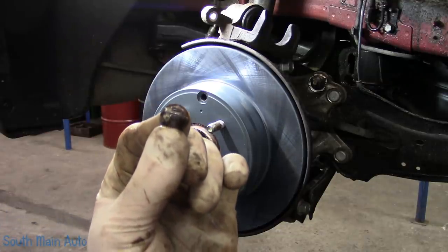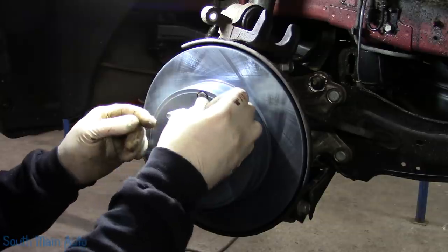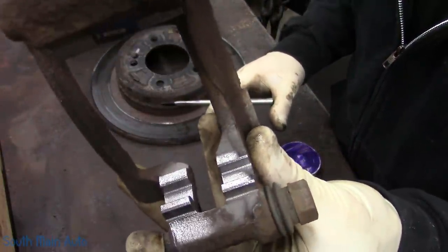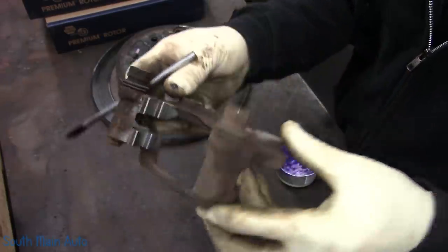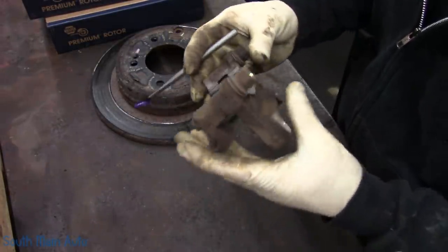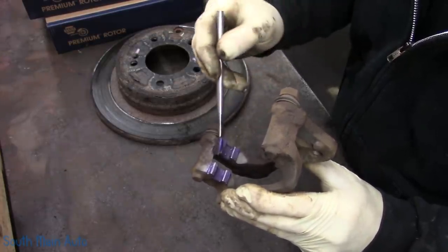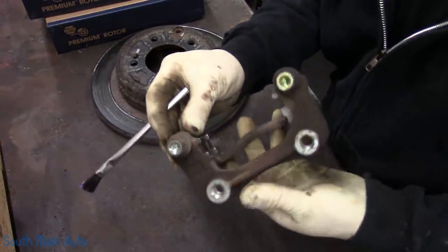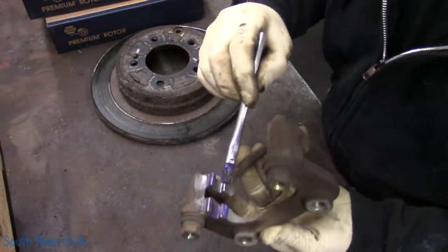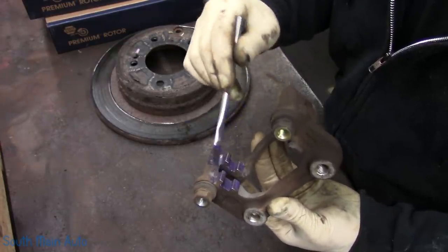When you look at your rubber plug, it has a flat side on it on the inside — the mushroom head portion of it has a little flat side. That goes down, against the face of the rotor or the face of the hub, and it just pokes in there. Now, like every brake job we've ever done, you have to clean your caliper bracket — whether you use a file or whatever you use, get the rusty bits out of there. And then we need to lube it. Some we Loctite, some we lube — I guess depending on the design, and probably also depending on where you live.